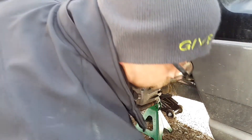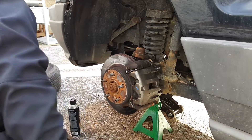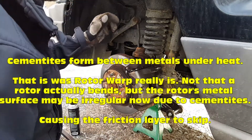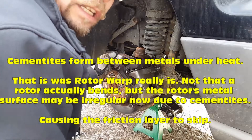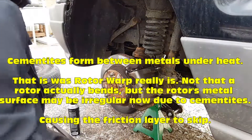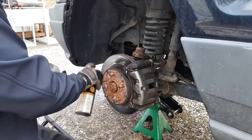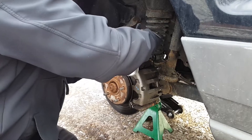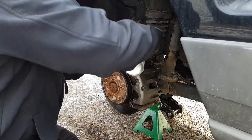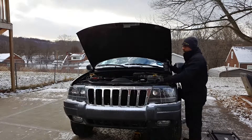Next step is to clean off the rotor because there's crap all over it. The one thing you do not want is cementite — that's basically when your pad leaves deposits on the rotor and you get that squeal or vibration sound. You need to clean off the rotor or you will have problems. I'm using a non-chlorinated brake cleaner from CarQuest. Upon bleeding we lost a little fluid — top it up but don't overfill.